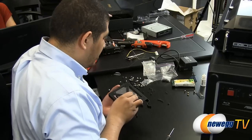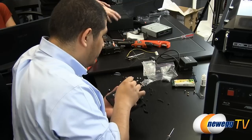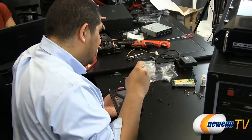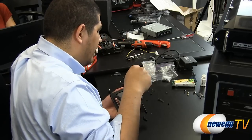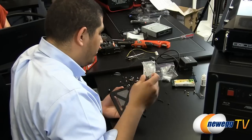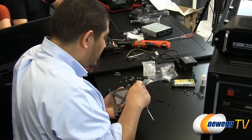Yeah, I mean, you should, but generally, if the board is designed for an 8-pin power connection, you should be utilizing 8-pin power, just because depending on the way that the power supply is designed, you don't know how that rail is being set up. So ideally, I wouldn't recommend splitting it. If the motherboard has an 8-pin connection, that's what you should use.